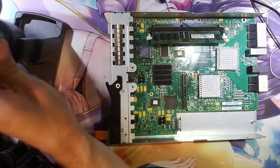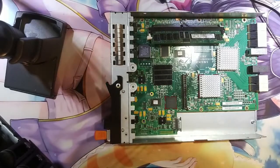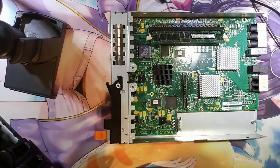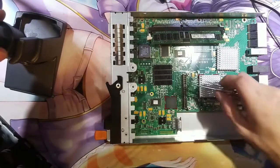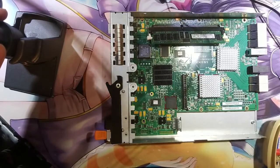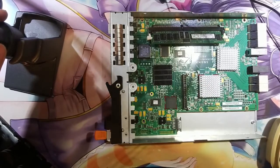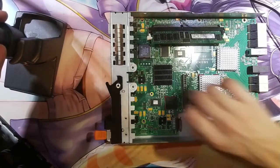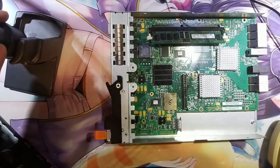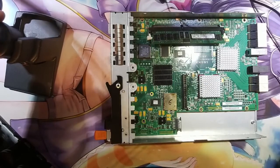Okay, so 390 degrees Celsius and 105 air should be fine. Let's grab some tweezers. Okay, and now we're gonna remove the chip. Let me just put some shielding on the FPGA just next door. You never know. Okay, so let's use a shield. Okay, perfect. And let's go.